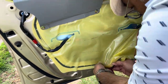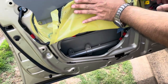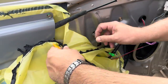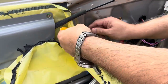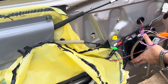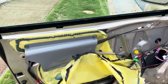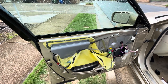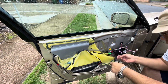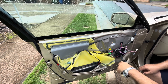On the left half of the door there's a plastic shield that you need to peel back. We don't need to take it all off — just peel back half and the right corner, and stick it out of the way so we can get at the bolts. You can also take the speaker out because we'll need that opening later. Once that's done, reconnect the window controls and see if we can lower the window.